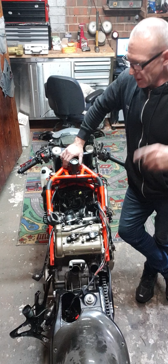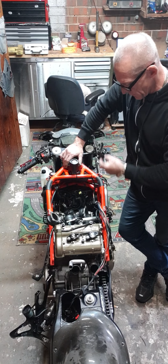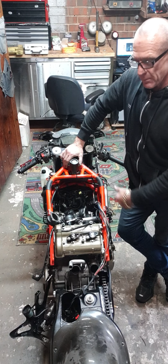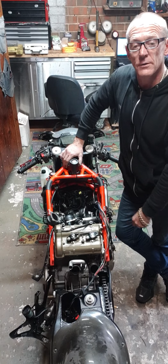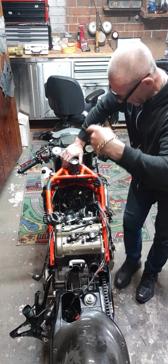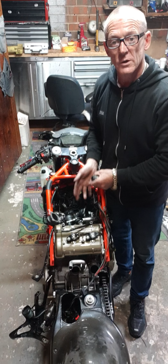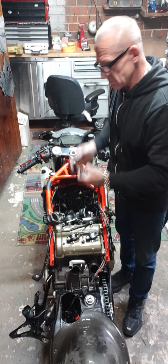one of them's the pump, so that's fine. That's circulating, but there's a return line, and it keeps a certain amount of pressure in the line. And the one that was going back in wasn't letting anything in. That's what was popping off. Petrol used to run everywhere. Anyway, I thought, hang on, that might be part of the problem. Why it's dropping a cylinder. It's overfueling, backfiring.